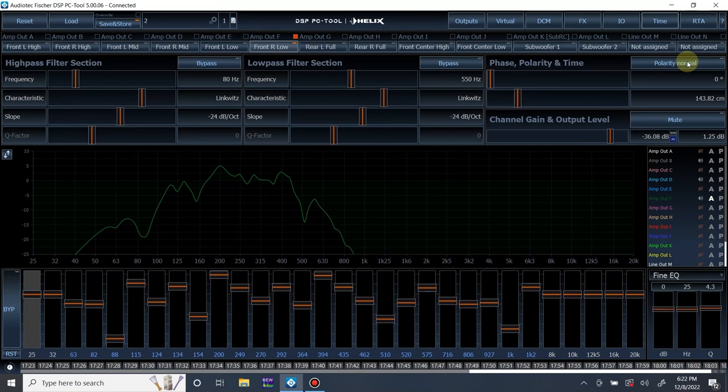So the right mid bass actually sounds normal when it's in polarity. The crossover sounds right when the mid bass is in. So let me actually play mid bass and see if maybe something got wired wrong or they purposely wired something different from the factory. And let's just see. Oh yeah. All right, so that has to be out. Maybe it's the mid ranges. Let's play the mid ranges now.